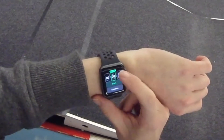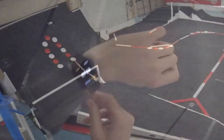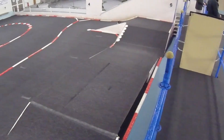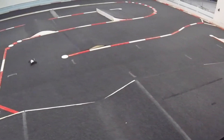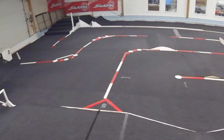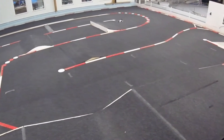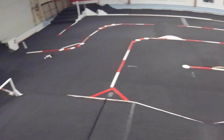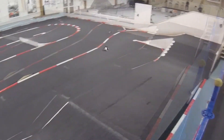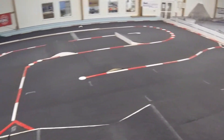And here is the first test. I drive around eight minutes because this represents a normal race — seven minutes plus the first inspection lapse and so on. The main goal for this test is to check the temperature. I put the timing of this motor to the highest value, which is 60 degrees.